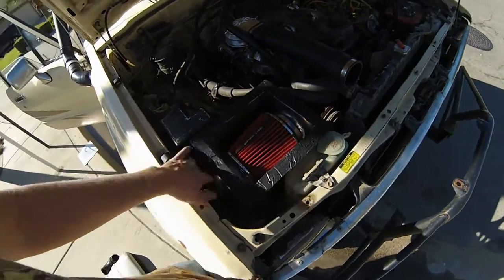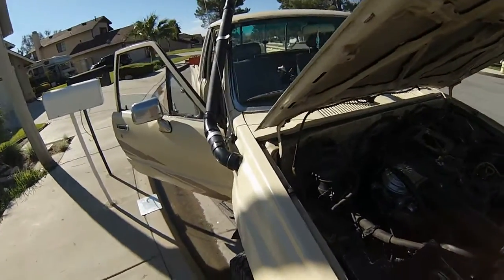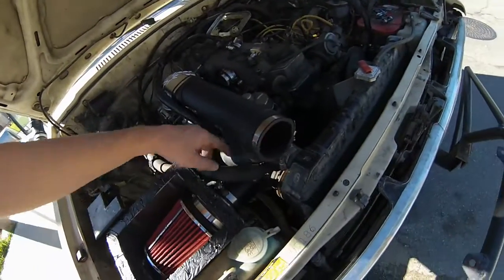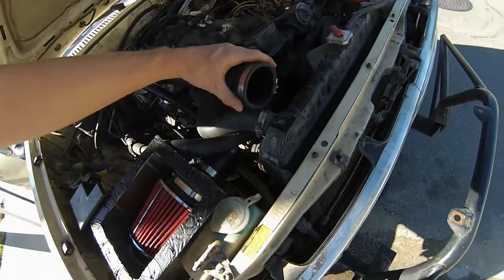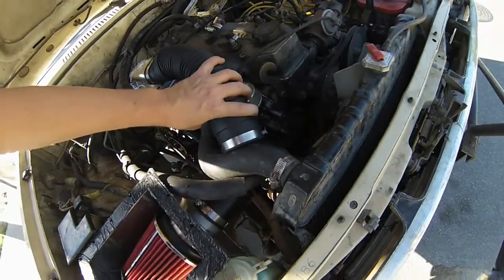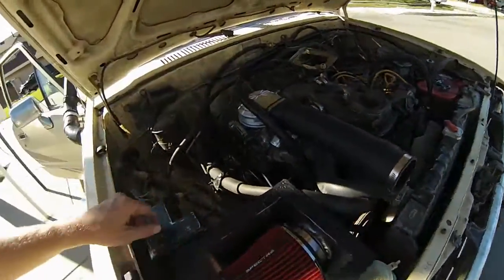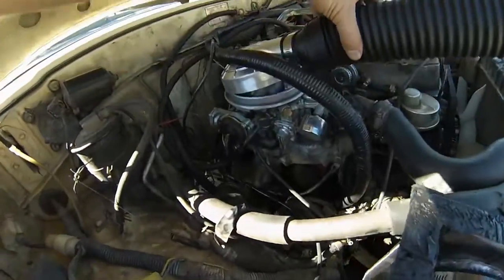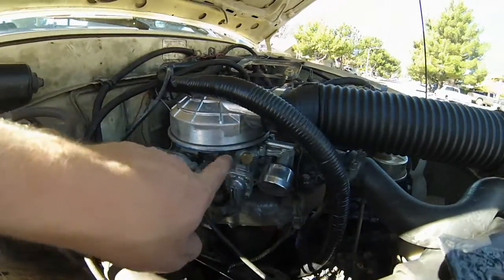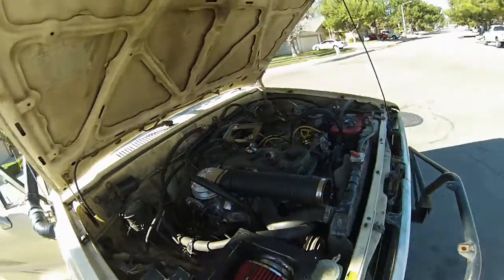2.5 inch. I bought these couplers at Home Depot. They're where the ABS section is. While I was buying all these little attachments, I bought these couplers. So this coupler is going to come out into a 90 degree, and there's going to be another 90 degree that couples to that, somewhat like that. That'll obviously be drilled down, bolted down. It's got a rubber seal around it, so it does seal. I had to seal the bottom right there with RTV to make sure it seals completely, so this thing's not going to leak air.